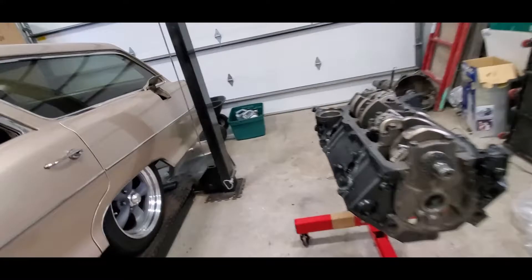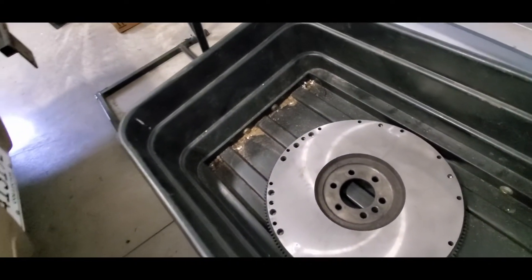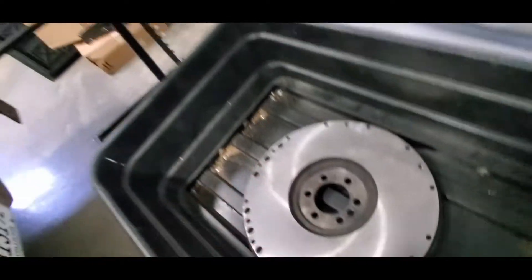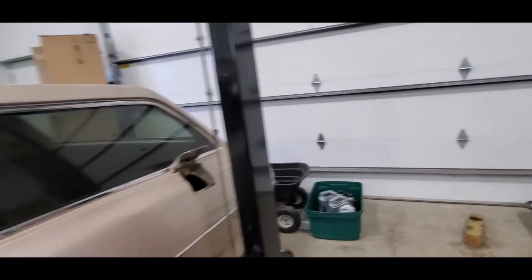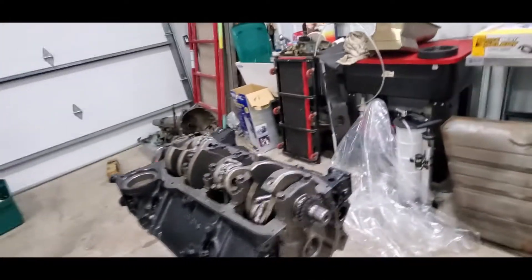In today's Bent 69 video, it's Saturday and it is bloody cold outside. I think we're going to get up to zero today. Obviously you can see the engine's back, and I'm going to tell a fun story. This flywheel is now balanced correctly to this assembly. They had to weld in some holes — this flywheel was balanced 180 out, so the index was not positioned on the crank correctly. Because that's how the balance was already done, that's what we're stuck with.